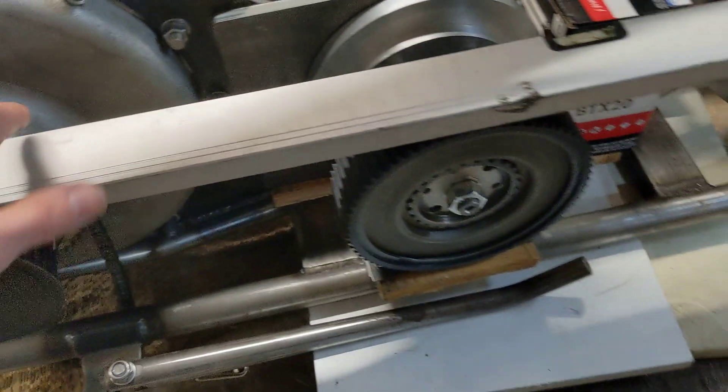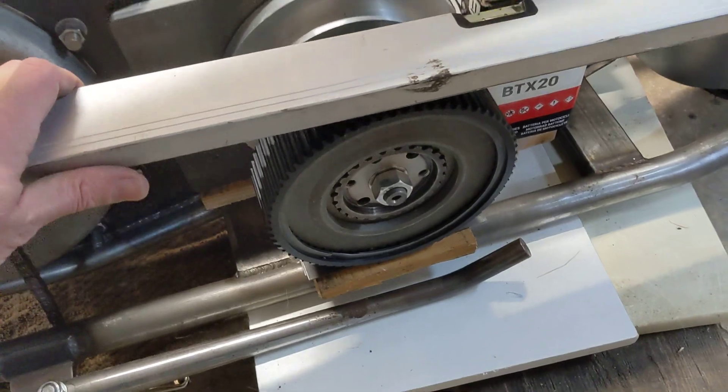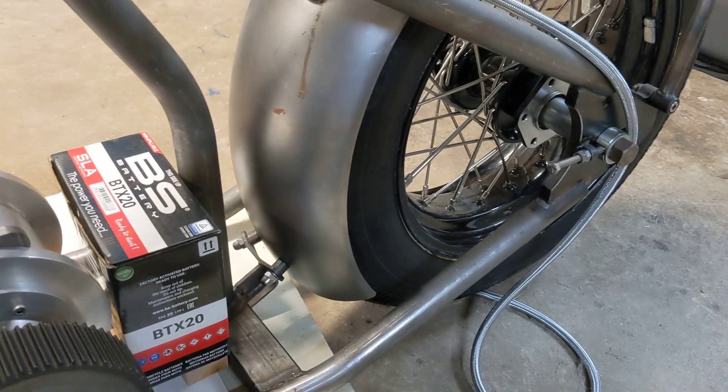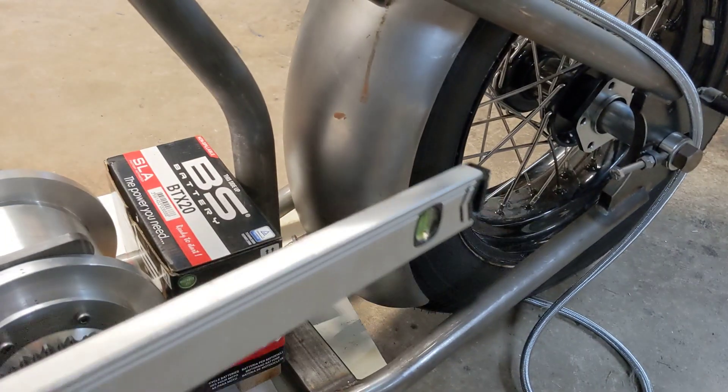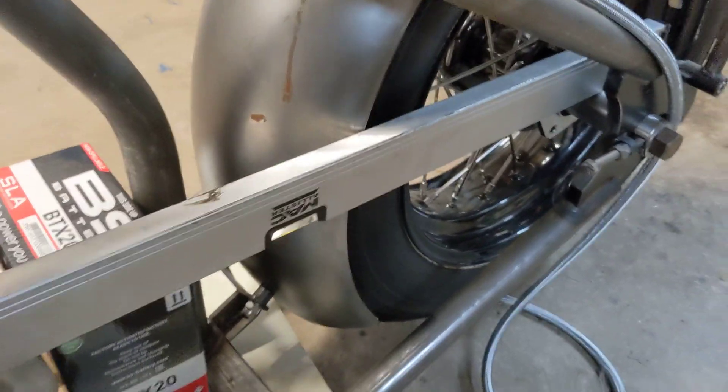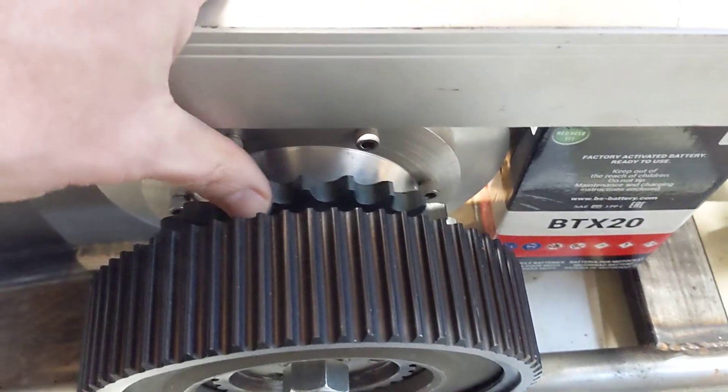That's how I've lined up the front pulley. The second part of the job is to make sure that when the chains are on it doesn't hit the rear mudguard on either side or rub on the tyre. So I've got the high gear sprocket there.